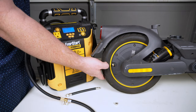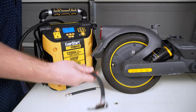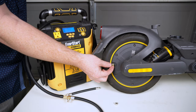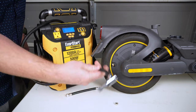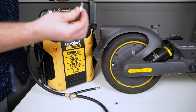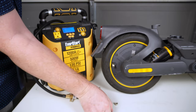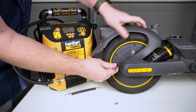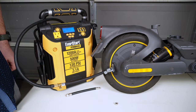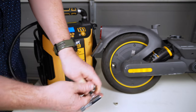These tires are small and they have a lot of pressure in them, so any kind of air loss can be significant and you want to minimize that. Using these tire chuck adapters makes it a lot easier. Now, one thing to mention: the valves on electric scooters sometimes are really flush with the wheel, which could make it difficult to get one of these lock-on tire chuck adapters into place. To solve that, you can get these valve stem extensions, which you screw directly onto the valve stem, then take your tire chuck adapter, attach it, put the lever down, power on the pump, and we're at 46 — these also have minimal air loss. Just lift the lever and you're good to go.